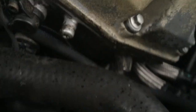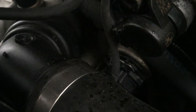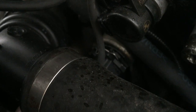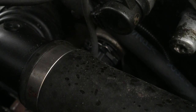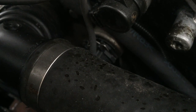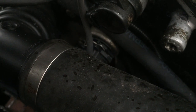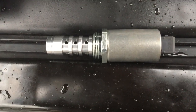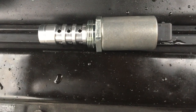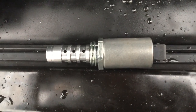There's a small clip right there — just pull it out and pull the plug off. Then take the bracket off — two 10 millimeter bolts — and wiggle it off. Do some WD-40, wiggle it off, then put the socket on, lefty-loosy righty-tighty, and install the new one. Put everything connected and install the air duct and everything, and you'll be good to go.